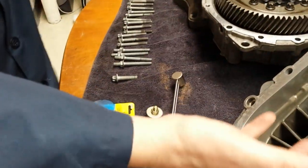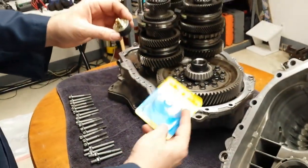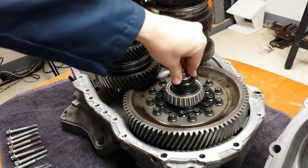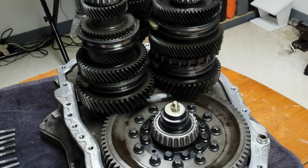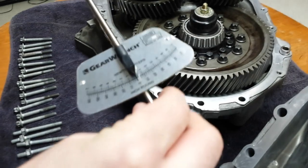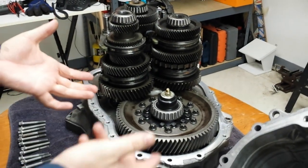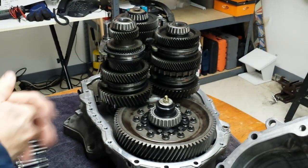I'll show you how I did that. When you put the case back on and torque everything down, I use one of these — it's made by Dorman, called an expand-tight plug. It's the kind that expands when you tighten the bolt. Once you get everything put together, you can stick this in there and tighten it down so it gets a good grip on the differential housing. Then you can put your torque wrench on there and spin it to see how much torque it takes. The new one, when you put it in, should be around 15 inch-pounds of torque. I measured my old one with the original bearings — it measured about five, which is what I'd expect for a fully broken-in set of bearings. The new ones will be a little higher, they'll wear in, and then they'll probably be around five also.